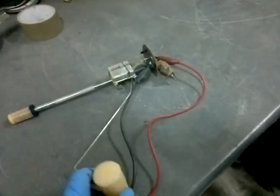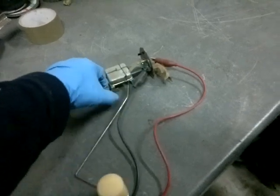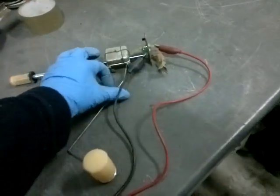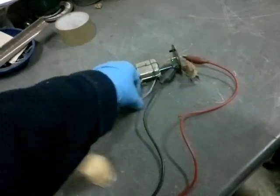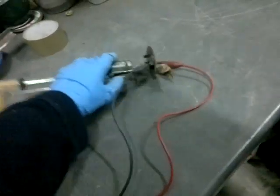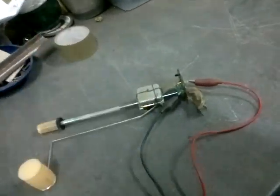That's the way to test it. If there was no change between the readings, then effectively the mechanism inside would have been very suspect. Sometimes you can get them going by wiggling — they can be very stiff. They might be set in the low position, for example, or if it's had plenty of fuel in it that's just gone stale, it may just be set in a higher position. Give it a wiggle round. You can't really access this internally, so I probably don't suggest it unless you know what you're doing — it's best not to.